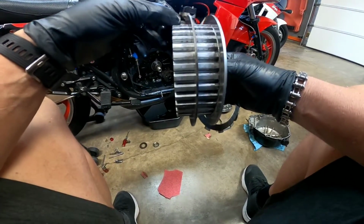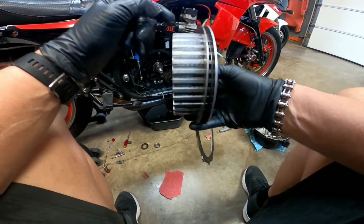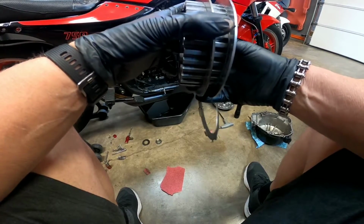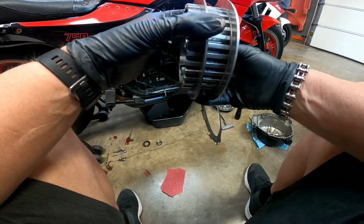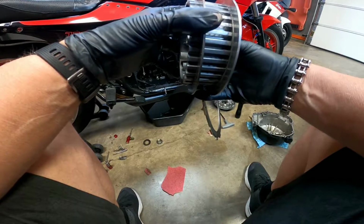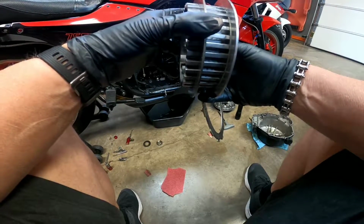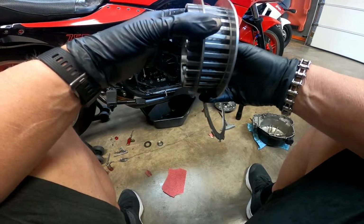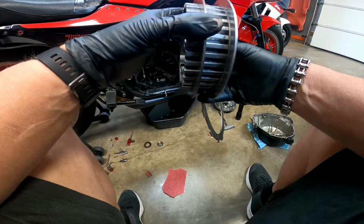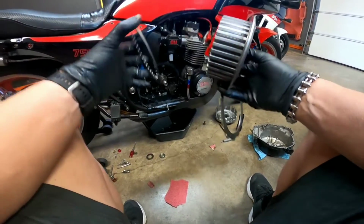You can see these little dark grooves. I've started to sand some of them. It's tedious, monotonous labor, but I'm trying to sand some of them smooth, because I think what's happening is when I'm disengaging the clutch, I feel it moving. They move like this when you're disengaging the clutch. Engage, disengage, engage, disengage. So I think that's what I'm feeling. Even moving it now, I can feel little notches in the steel. So I think that's it.